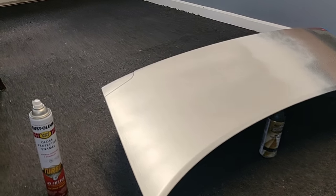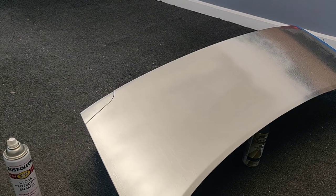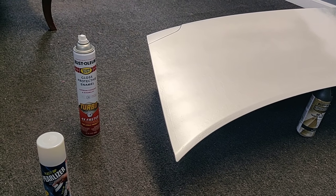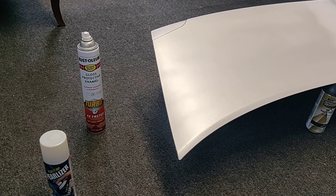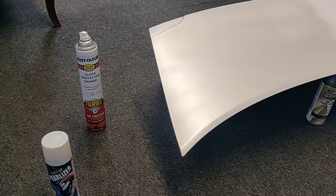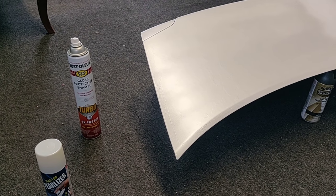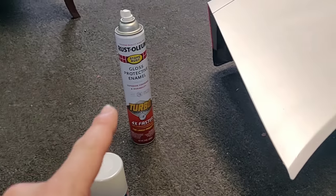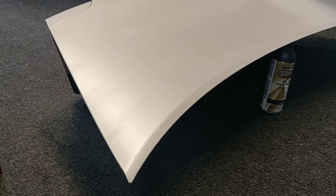This was kind of a strange video - it might not be something any of you guys are trying to do, except if you have a white car already and you want to turn it into a pearl white car. When I called Dip Your Car, I was trying to explain to them that if I went and got my car painted white or painted it myself, could I let it fully cure and then add just the pearlizer or the pearl clear coat - I have the glossifier and the gallons and I added the pearls. Can I just add that to the top of the car, get the pearl effect, and protect the paint too? They told me that won't work and that I had to lay down white Plasti Dip first. But I can see here this is a gloss paint and it came out very glossy. I did not let this fully cure - it was still tacky when I sprayed it on - but it went on very nice, and I'm interested to see how it might peel up.